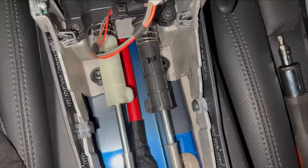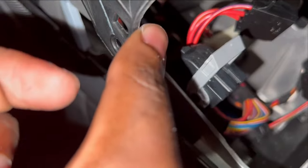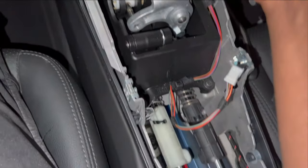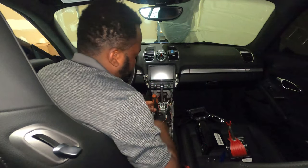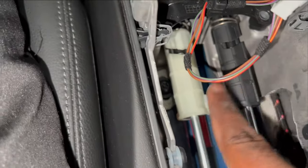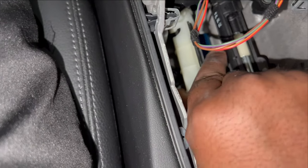This is how the shifter is mounted — you have these two areas connected, one going to the back of the car and the shifter itself. Make sure your car is in neutral — I usually park in first, so once you put it in neutral it releases everything. Remove the four T25 screws to securely remove the shifter. Now you have to remove the shifter from the linkage: push it to the front and twist it to reveal the connection — do the same on the other side.